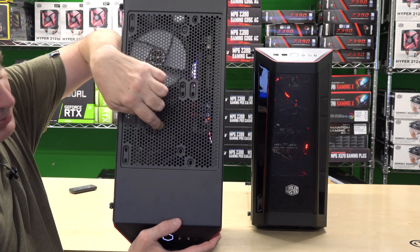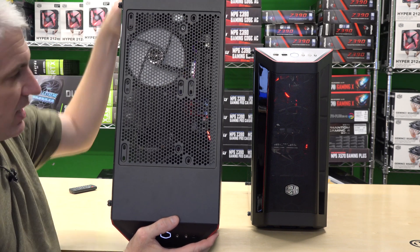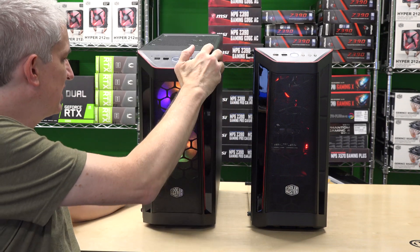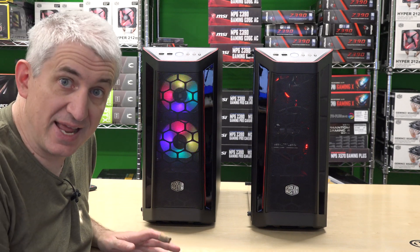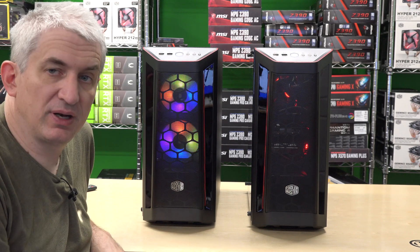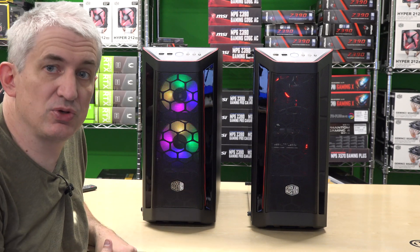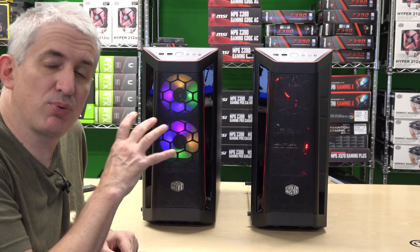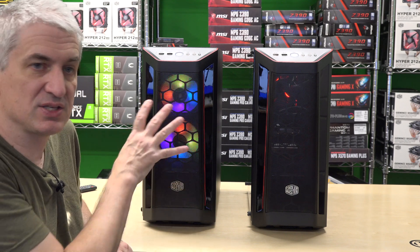I have the ability to put another fan here, and I could actually put a larger fan if I think that's necessary. You should only ventilate as much as necessary — overventilating a case with tons and tons of airflow, you can do too much. What you end up with is excessive dust buildup. So there is a proper amount of airflow for each case, and it's on a case-by-case basis.